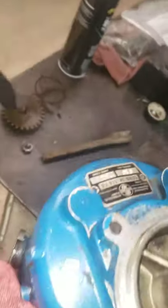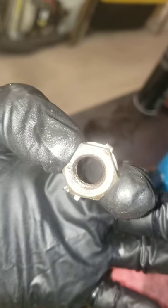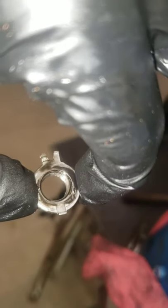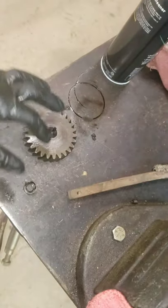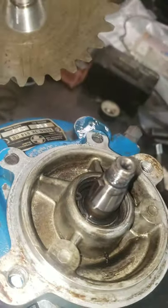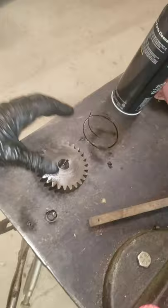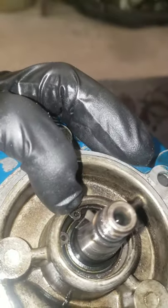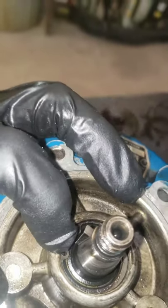This fitting here takes a 3/4 to take it off, and this is a lock so it doesn't spin off. It's tapered right here so it fits in perfectly — can't miss it. There is a snap ring you have to remove out of there. It's the front seal that's what's causing the leak into the block itself.